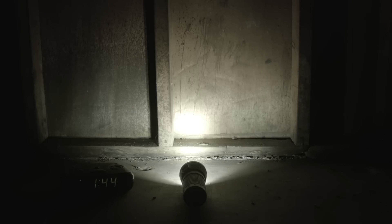You can see a red warning light blink before the battery runs out telling you to recharge — it's not mentioned in the manual, but it's there as a low-voltage warning. Low mode delivers a few hundred lumens of sustained brightness for over 24 hours — I got a full 26 hours and 11 minutes of runtime, though different batteries, room temperatures, and mixing modes will affect that.